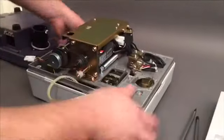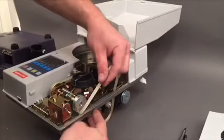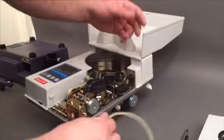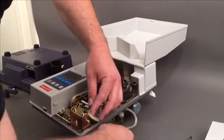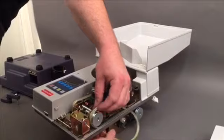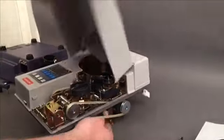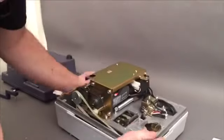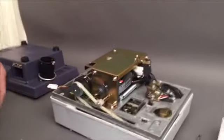And the drive belt goes through the frame. So to get it off, you're gonna have to flip it back up here and pull it out through there. And then same thing, put in the new one, put it over this wheel first, up top, make sure it's on like that, roll it over to this one, and then push this down on this little pulley so it's under it like that.